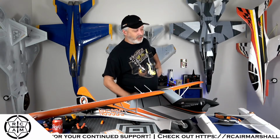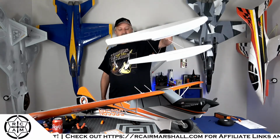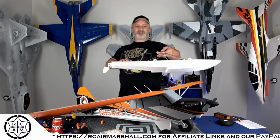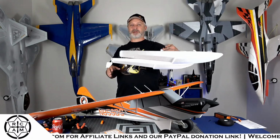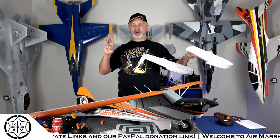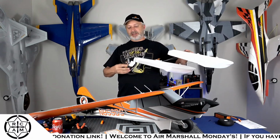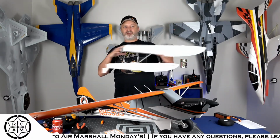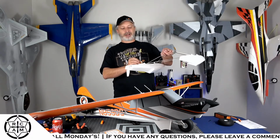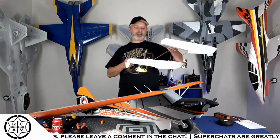Yep. And I've got a float plane, and I like it a lot, but I wanted something bigger. The floats that work with the Husky, I've got them here. It's already got all the brackets and everything installed. Getting the main gear off is only 3 bolts, and getting the brackets out to put the floats on is only 6 bolts. So swapping the main gear out for the floats is going to be really simple. And then I've got a line here that I would run up into the fuselage, and there's already a hole cut out for that, I believe.